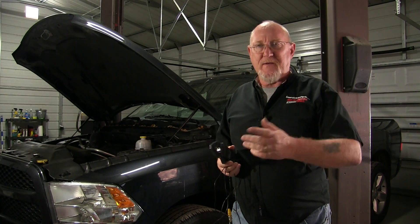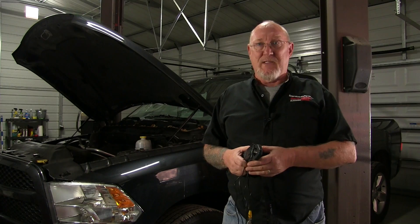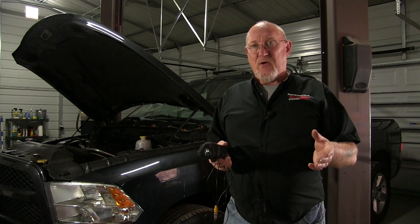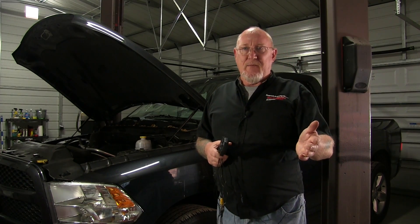The relative compression test is a very quick way to check the mechanical integrity of the engine — it saves a lot of time and beats doing a mechanical compression test on every cylinder. And if I do see a weak cylinder, I at least have justification to go back to my customer and say: 'You have a problem in the very back of the engine compartment; it's going to take a few hours to dig that out and find exactly what's going on, but here's what it will cost you.' That's one of the great reasons for using this test.